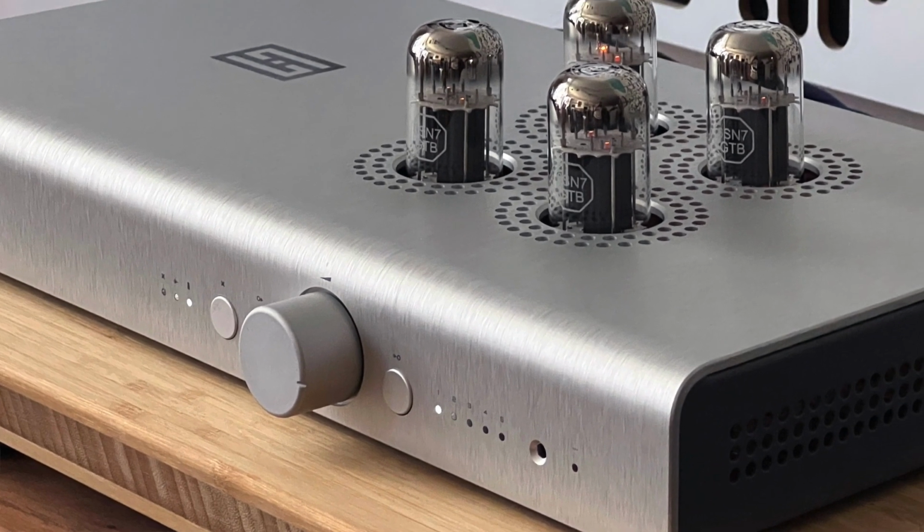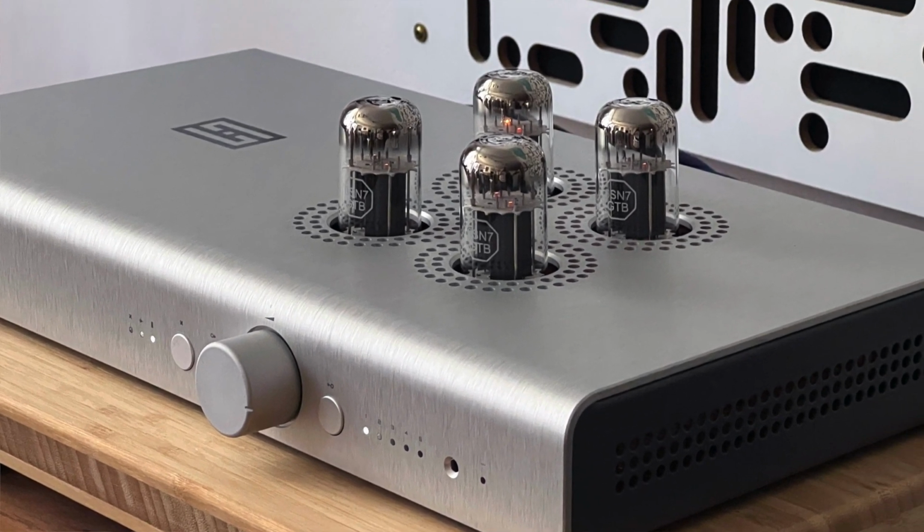It feels really good. Now I will say that when you turn it to increase or decrease the volume, you're going to hear click, click, click, click, click of the relay switching on and off to change the volume. But the advantage of a 128-step attenuator is that it's very precisely matched. Left and right channels are very close, so they don't drift over time and stuff. So even when you listen at really quiet levels, left-right balance is right on the money.